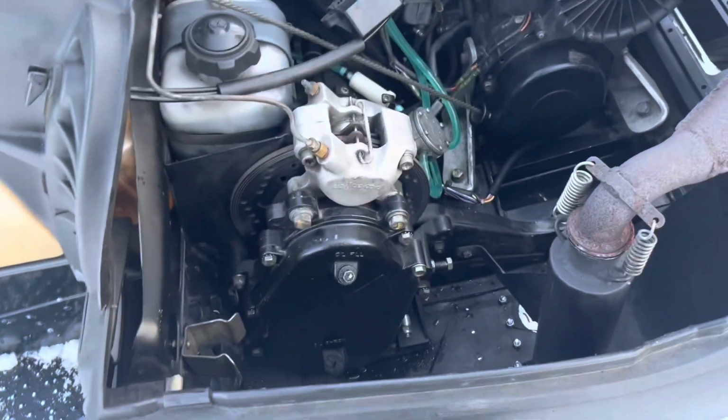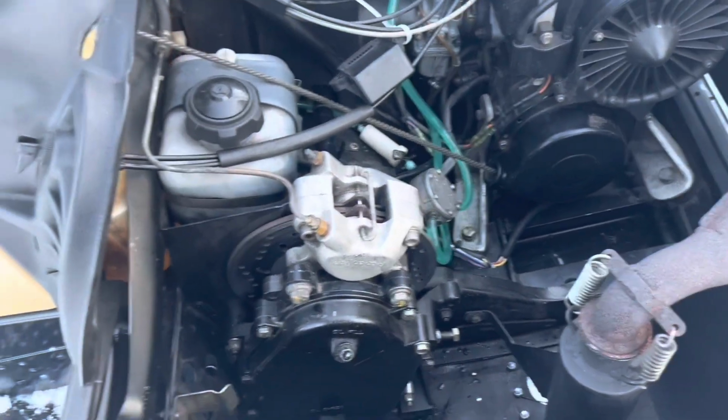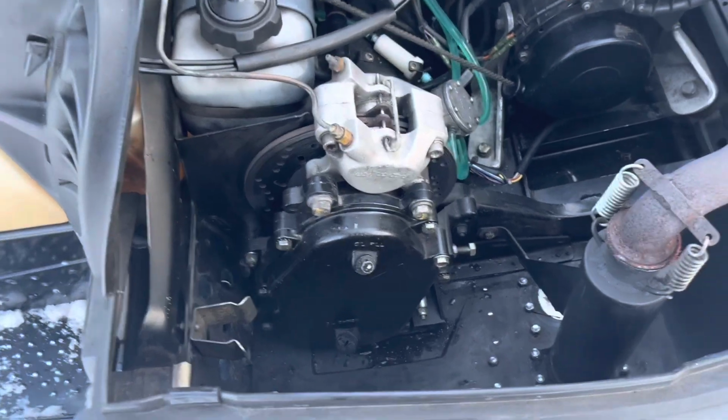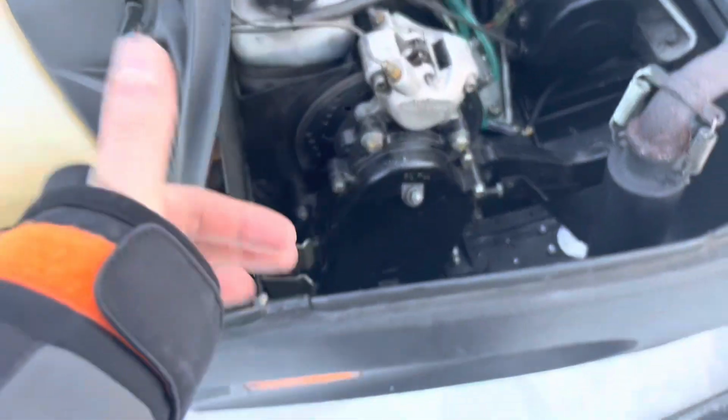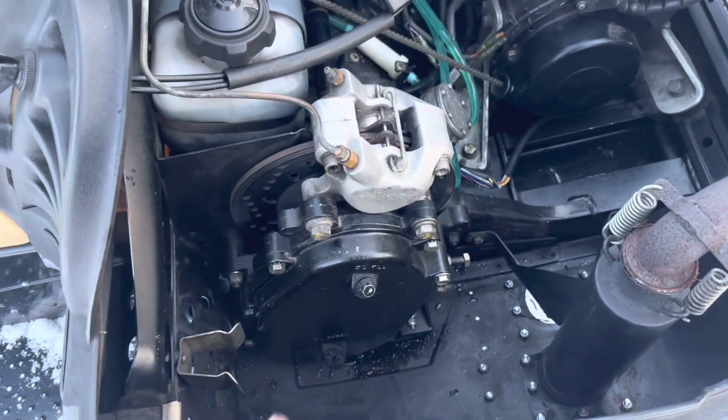We were messing around with the clutch and we were rotating it, and we heard this little clicking noise. I'm like, what can that be? Open up the gear case and there's these studs in there that were snapped, or one was, and the bolt was rolling around in there. Also changed a bearing in there, and yeah, that's working now.